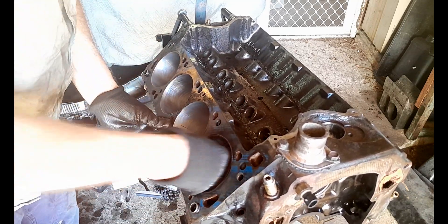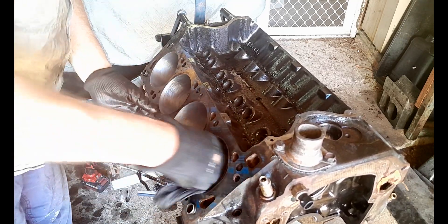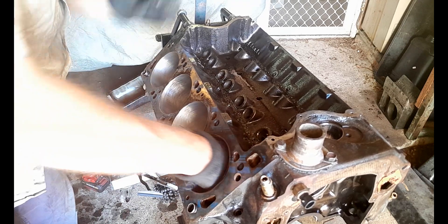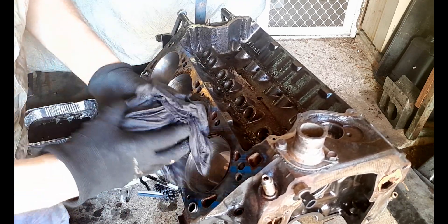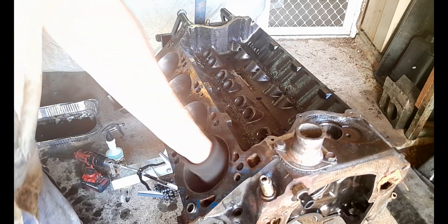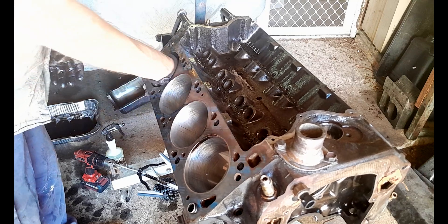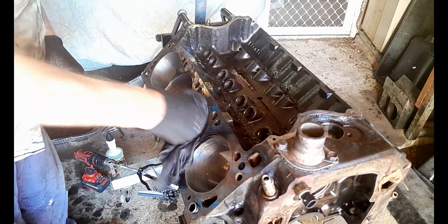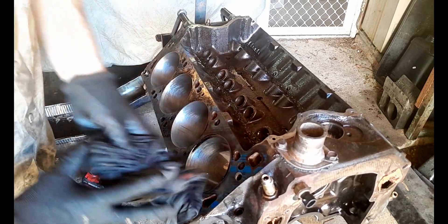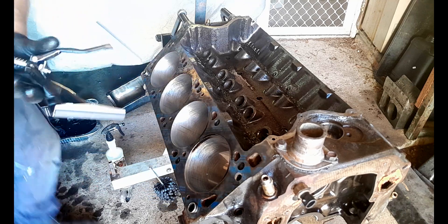When I do run this engine and break it in, what I normally do is take it straight to the mountains — a particular mountain in my local town. I've got a manual full forward pattern manual valve body in my transmission. I put my car in third gear and load it up that hill, then engine brake it back down probably five or six times. If my car had a tow ball I'd put a trailer with a load in it to really bed in those rings.